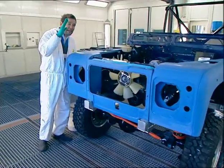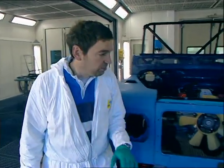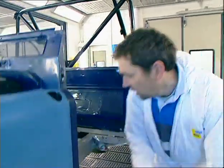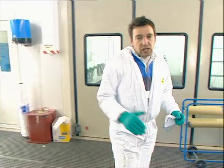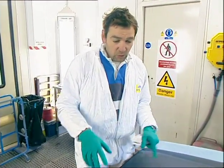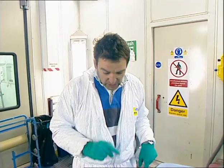The wings are now on — ultimately they're only bolted on by a few bolts. I've stone chipped the inner wheel arches, which is practical but also gives a really nice finish. The roll cage is on, powder coated in black, because the way it fixes down is part of the tub. The panels have been flatted since priming — and here's why that's important: with guide coat on top of the primer on the bonnet, you can see an outline where the filler is. You can't feel it but you can see it, and if you put gloss on that it would look horrendous. So the next job is to flat down the primer using 400 grit on a block to get it absolutely smooth before putting gloss on top. There's quite a lot of flatting still to do, then a couple of hours of masking before Robbie can put the final paint colour on top.